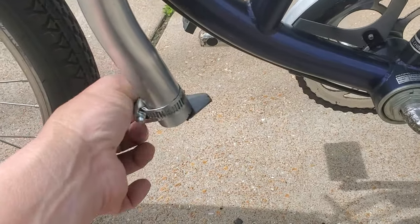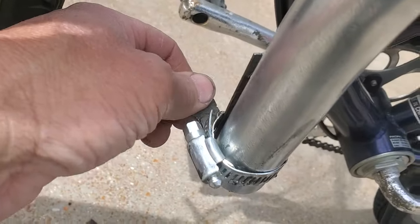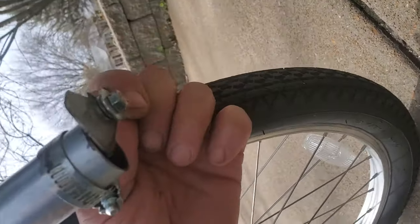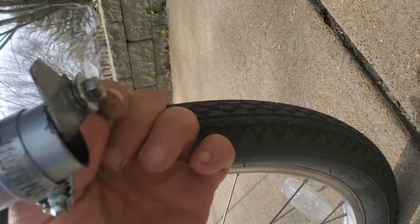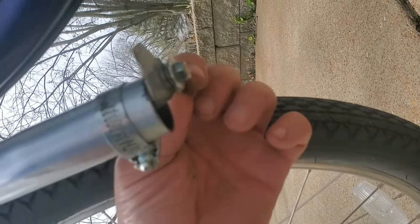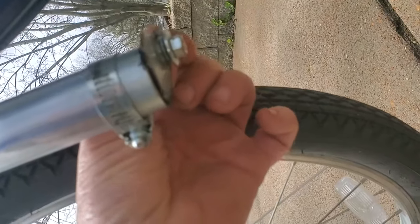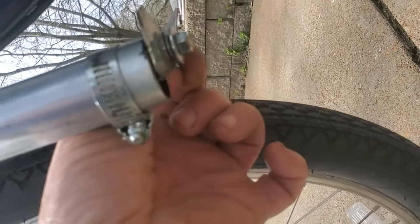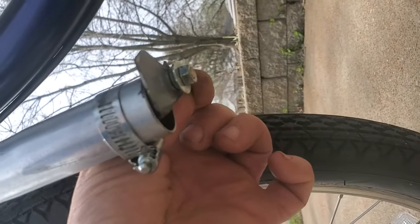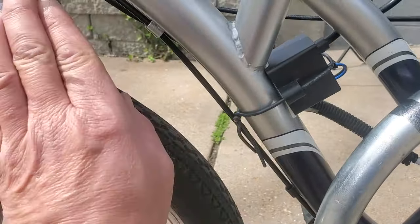and the amount of back pressure you can control actually by this little valve here. If you can kind of see what's going on here, depending on your temperature outside, your elevation, your engine's going to be performing differently depending on the conditions. And so you can get to a point where you're tweaking this to get the right amount of back pressure for your particular environmental conditions, okay? And that's just something to mess with should you decide to get this bike.